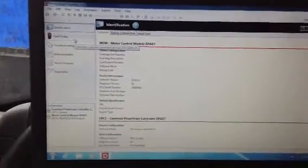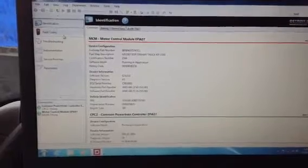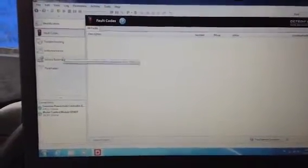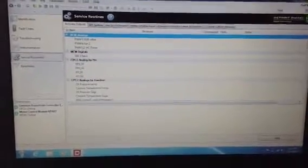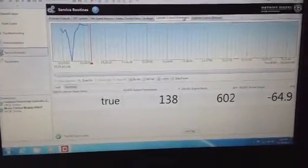It's still loading up. Here it's showing you all the truck information — the mileage, the hours it's been used, the VIN number. No fault codes are being shown right now. All we're going to be doing is showing you how to do a cylinder cutout test to make sure all cylinders are firing in the proper order. We're going to click on the cylinder cutout.